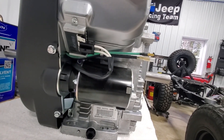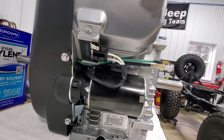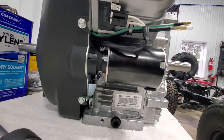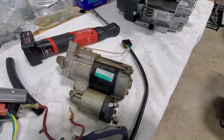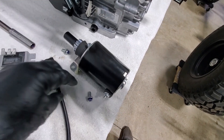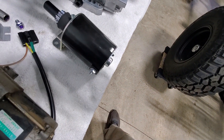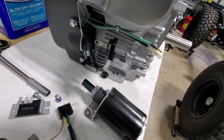Here's our new motor. You can see the two white wires and the two wires coming from the starter. We're going to disconnect those white wires, remove the voltage regulator, and remove this starter. The starter is on two bolts — fortunately they are bolts, not studs. The John Deere starter is a little different in its setup, so I'm going to have to remove a little plastic guard and cut that with some snips. Then the new starter will bolt right in.